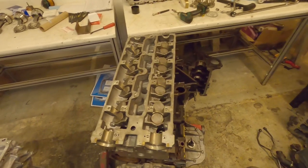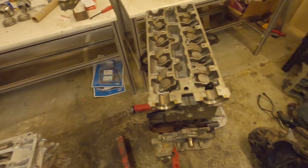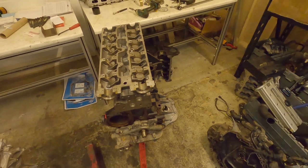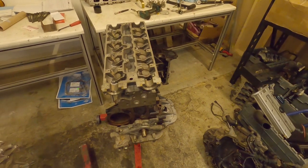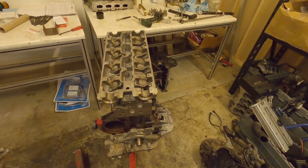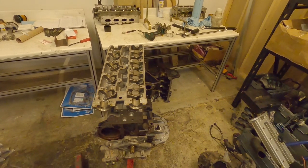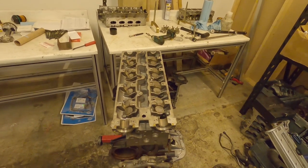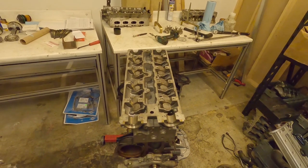The head bolts are all in at hand tight. Some things to note with torque on the head bolts: if you're using non-standard bolts such as ARP studs, the torque settings will be different. There'll still be a tightening sequence — just like the other bolts, you still have to go in a certain order. For these standard head bolts there are actually four steps: a torque, and then three sets of 90 degrees and a final 15 degrees.